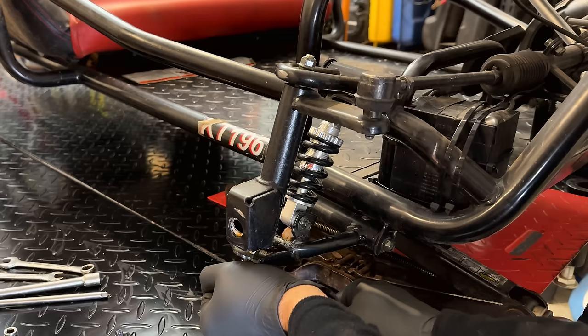And it seems like we do have clearance. Let me just double check. Usually around 5 thousandths for the intake and 7 for the exhaust. And that's actually the minimum spec that Honda has. I think they allow up to 7 thousandths on the intake and 9 on the exhaust, which is a bit much, but it's better than too tight. So in this case, it does not appear that a 7 thousandths fits, which is good.